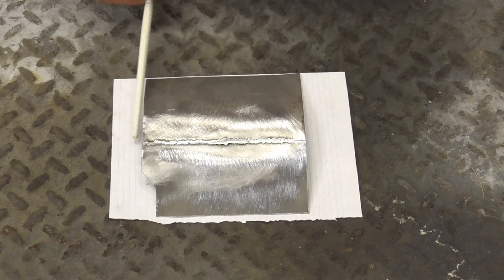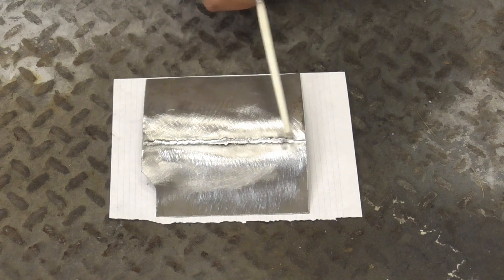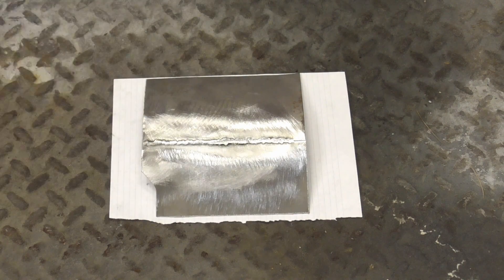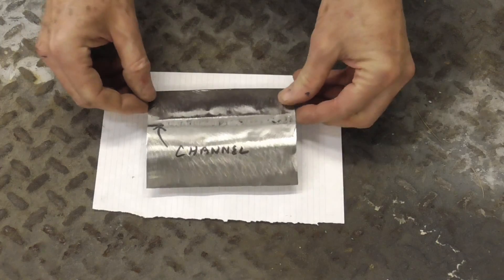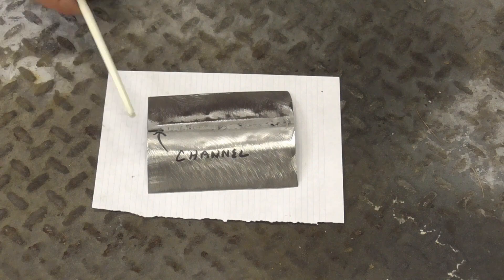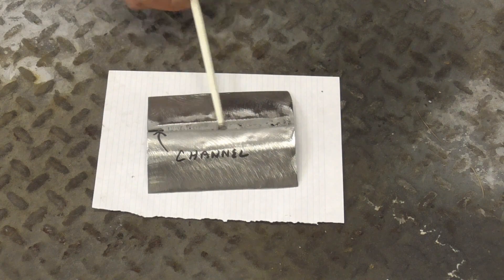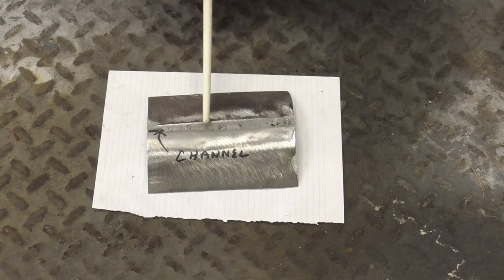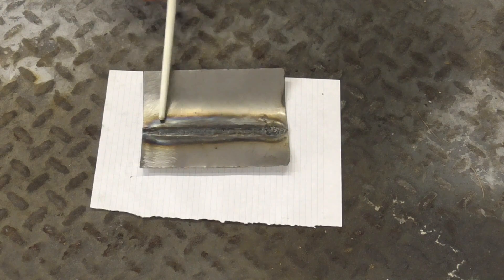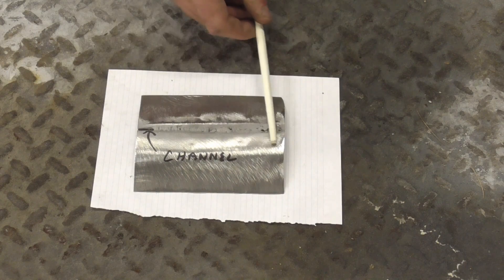In one situation, we butt welded and ground the welds down just a little bit — not all the way flush — so we can tap the seam down with a body hammer and fill. In the next example, you can form a channel using a tool — Eastwood makes one, or you can use pliers — form a channel and then fill it in with MIG welds. It's not very pretty, but on the back side you can see good penetration; then just grind it clean and fill that channel.